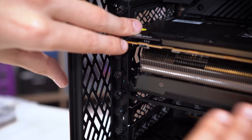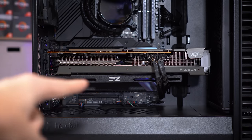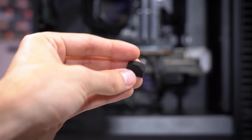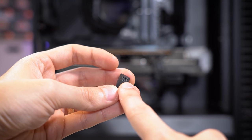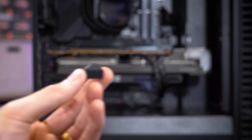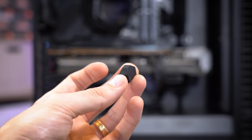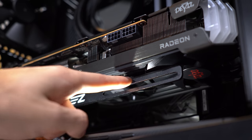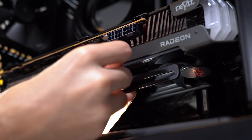I've purposely chosen a large card to demonstrate this with, because if it works for a card like this it will probably work for your smaller graphics cards as well. You can see the bracket is more or less perfectly horizontal, but the card definitely starts to sag further toward the right. Now I have not installed the little rubber mount yet — this is what is going to make contact with the graphics card. You can slide it forward or back along the bracket to position it where the card will allow it.